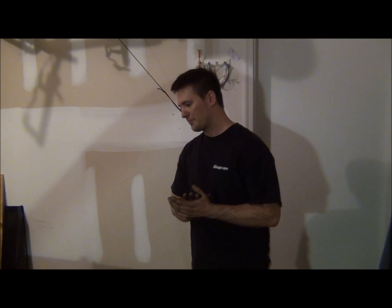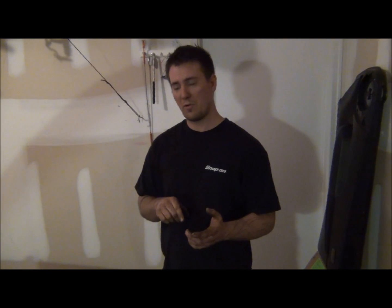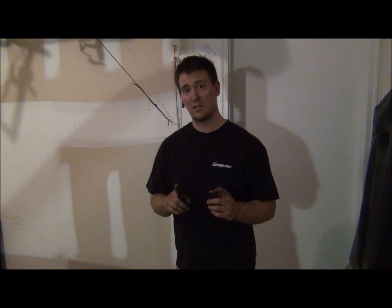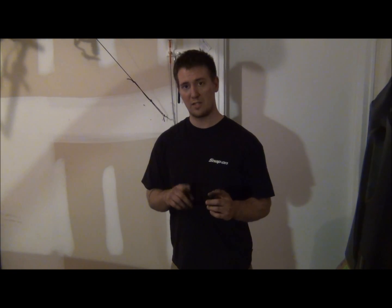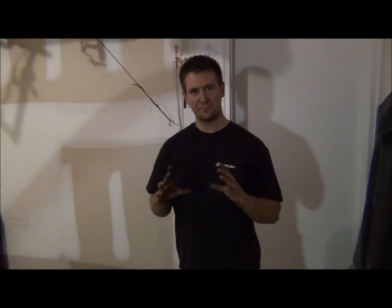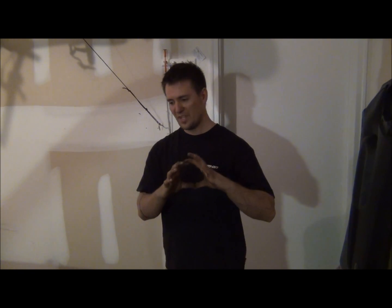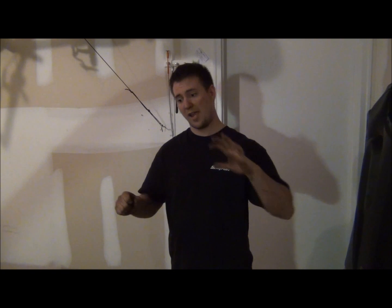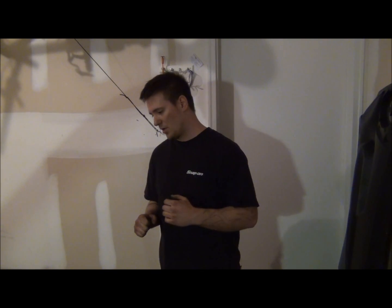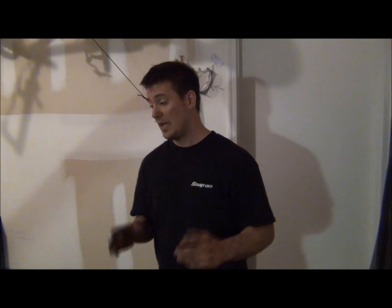Being that this is a Honda motor, the Honda motor spins backwards from what a normal motor would. Now, don't mistake that the bolt is left-hand thread. It's not. It's still a regular right-hand thread bolt. On a normal factory crank pulley, it looks like a socket itself on the inside of the pulley, and there's a special open-ended tool that fits in there. You put a ratchet on that, feed through your 19mm, and with a breaker bar, break it loose. Well, I've got aftermarket pulleys on this car, so that setup's completely gone, and I don't have the tool anyway.